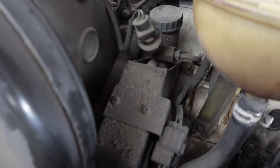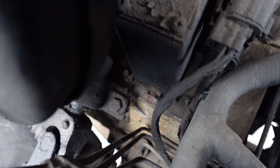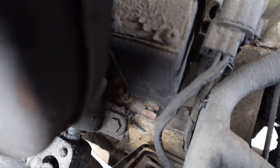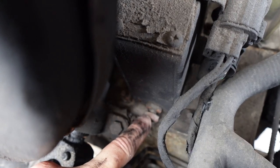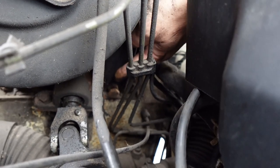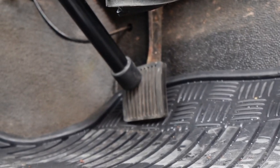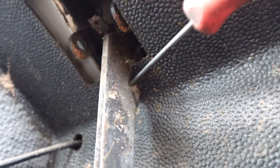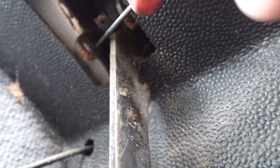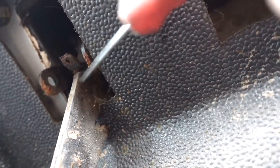In our TD5, in the engine bay, there is the clutch cylinder housing, and the bolt we need to wind off is right down here. We're just going to wind that off a few turns to enable us to get the pedal as low as possible. It's already quite low so I don't think it'll make too much difference, but we'll do it anyway. That's the top of the pedal — you can see the notch in the arm where we'll be putting our U-bush, and at the top these two plates are where the spring locates.